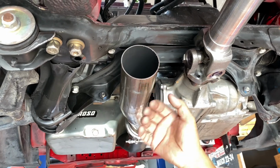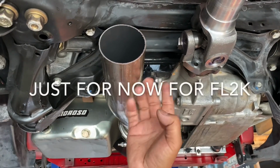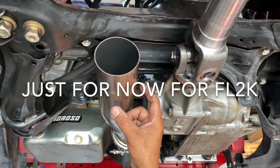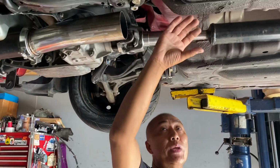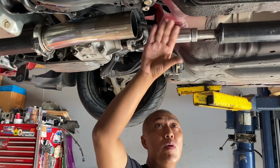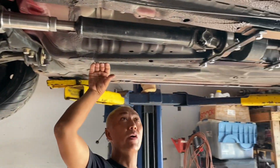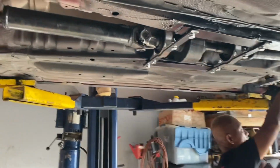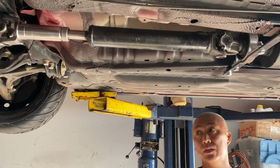And we've got the downpipe installed and the exhaust. So what we're gonna do for this event is just bring it out a little bit more, bring it in a little bit here, and then just dump it here for now. But eventually we're gonna come up around this way and get one of those oval pipes, a 3-inch oval. We're gonna come this way with it, bring it along here, and out the back with the stock stuff when it gets back there.